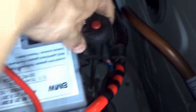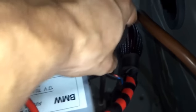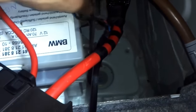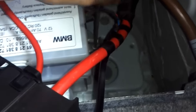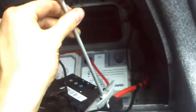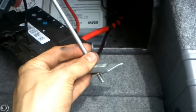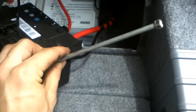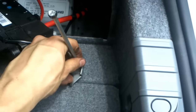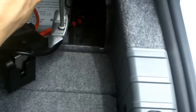You leave a little black leg in there. The last bit is taking off this bracket here at the bottom that holds the battery in. In their wisdom, BMW decided to save weight or money, so they weren't going to put the big leg on the newer style ones — you might not see this big rod here. Otherwise you need a 3/8 extension all the way down to the 10mm at the bottom. The big shaft is really helpful just to get it in, sight it, and drop it down when you're ready to put it back in. This sits in like this, that side holding up against the battery.